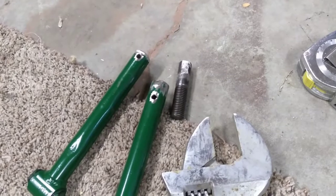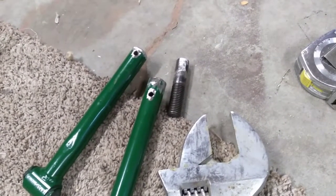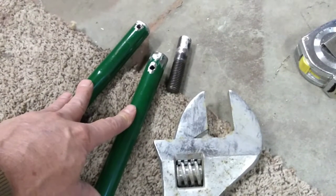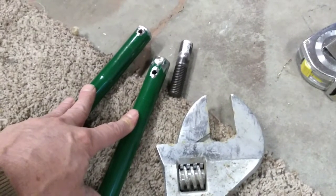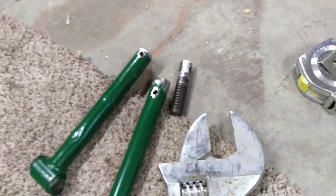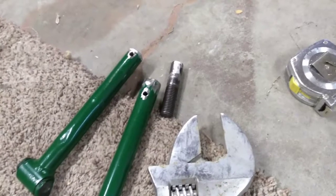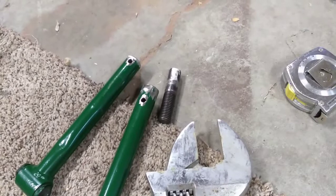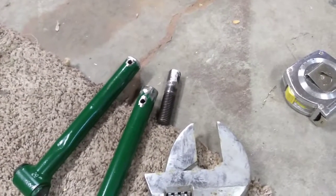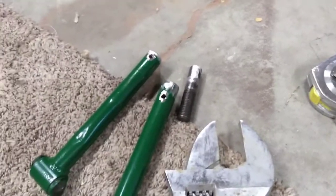The one thing you'll notice is that I'm putting that giant chunk of metal in there with that bolt, and it is going to add to the weight. But this car is designed to be ultra lightweight, so these pieces of tubing are thin wall. I am more concerned about strength here than lightweight. To replace these parts with new ones for a Lotus Europa would be nearly impossible — I'd have to have them fabricated. Since this is a low-buck project, I'm going to approach it this way: yes, I'll sacrifice maybe a half a pound of weight added to this thing. But when I'm done welding it up I'm going to have something that's plenty strong, and once I've ground the welds down it'll look just like normal.